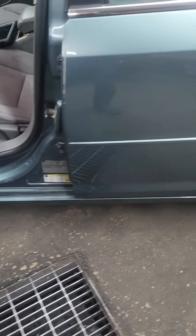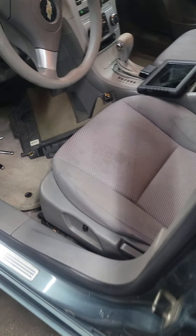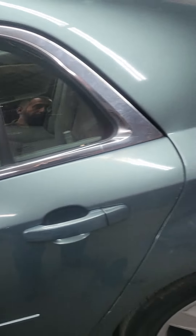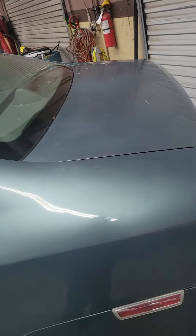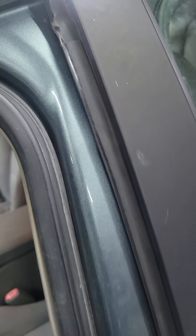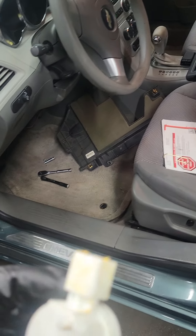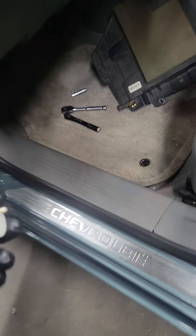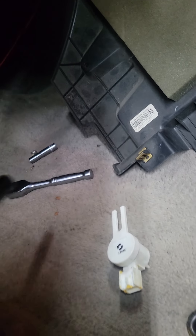Alright guys, 2009 Chevy Malibu. My customer was complaining about the brake lights staying on. This is a common problem — she had a recall a few years ago and took it to the dealer, they fixed it. Now they're refusing to do it again. I have the paperwork here. We have a brake pedal position sensor failure.